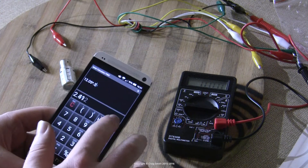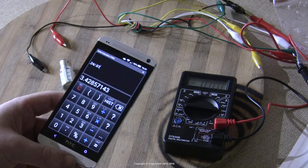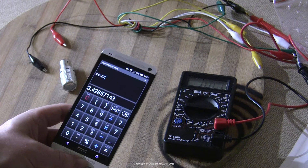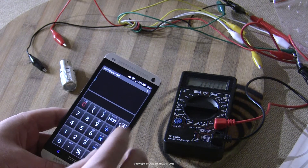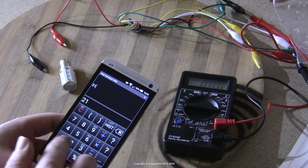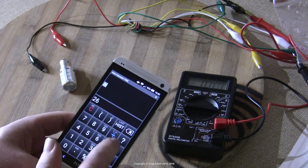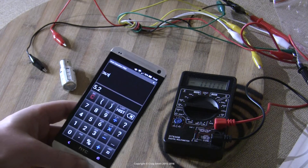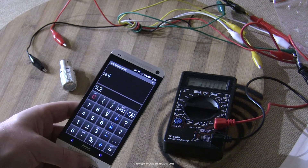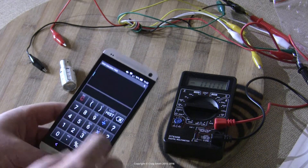Now that's quite a lot of wattage for an LED bulb to be drawing, but here's the first problem. The ratio between 0.24 and 0.07 is 3.4 — that's the multiple between the low and the high power modes. But the ratio between 21 plus 5, which is 26, and 5 in the filament bulb is 5.2, which is obviously a lot more than 3.4. So the 5.2 is what the LED should be emulating, but it's not. The difference between the low and the high mode is far too small.